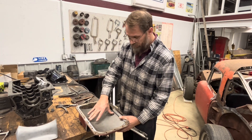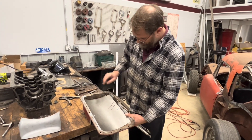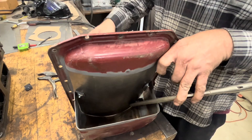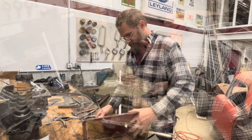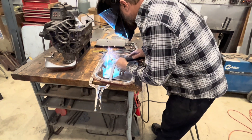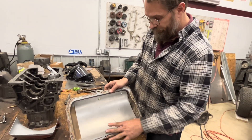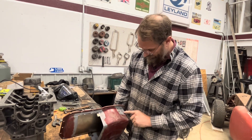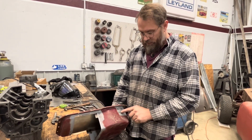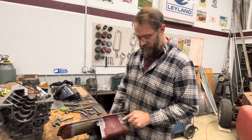I got those first two brackets tacked in here, transferred through the holes, drilled them, put a couple bolts in here, and now I'm working on the back ones — which are not so easy to clamp, which is why I'm doing all this while the pan's cut apart. Now I've got all four of those tacked in place, transferred and drilled so the bolts are fitting. One thing I did when blasting was make sure I took the paint off the outside where these brackets are going to be welded, so the penetration doesn't pull any paint in and contaminate the weld and create porosity.